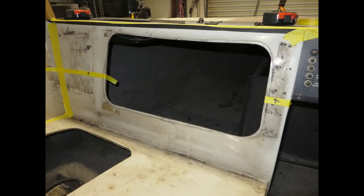Okay, now I like to mark the right side of the deck, right flush with the bottom of the dash. That's a short 2.5 inch cut there. Now coming up right next after this is me actually cutting this deck away. Note that I'm wearing eye protection and a respirator combination, wearing leather gloves because I'm going to throw up a lot of dust here. You can cut this using an oscillating saw, it just takes a little longer.